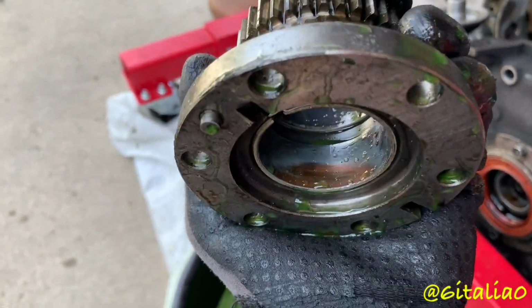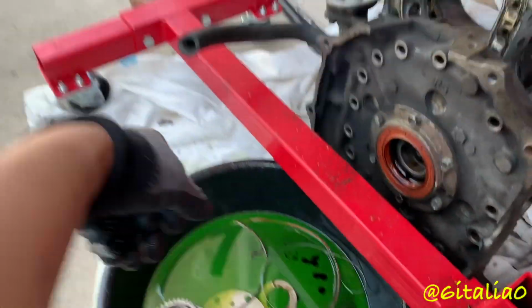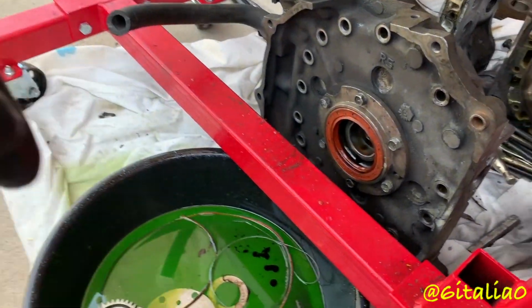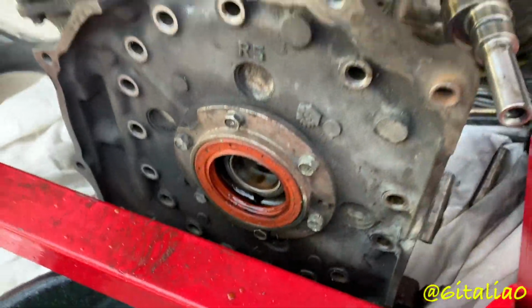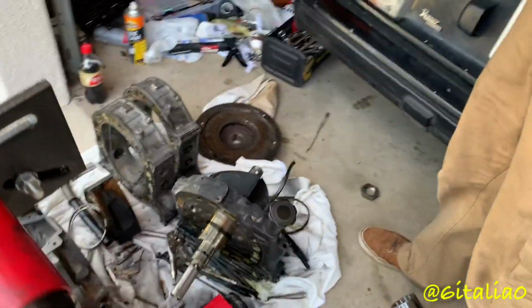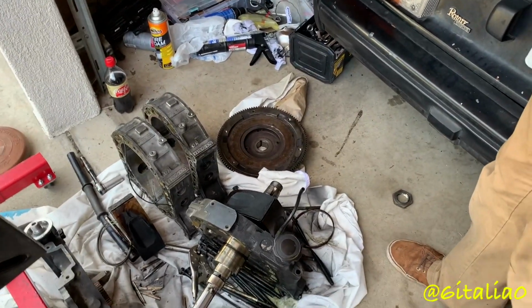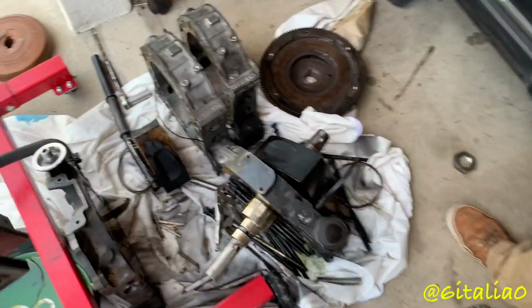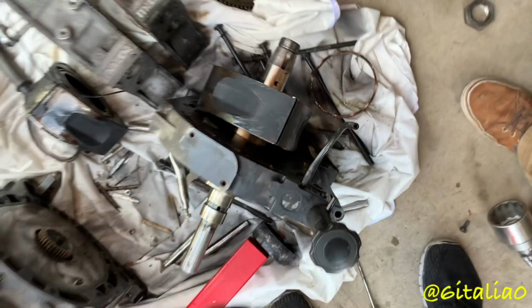Anyway, the front stationary gear bearing is bad, a lot of copper on there. So that's a first indication. Looking at the rear, I also got wear on there. And if you remember my Killer B, it was the front rotor that seized to the eccentric shaft. Well, on this 12A, it happened the same except in reverse. So this is seized to the eccentric shaft.